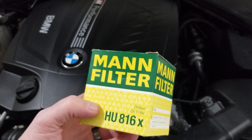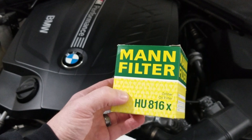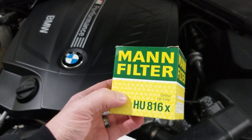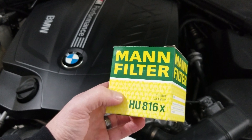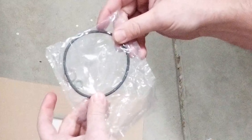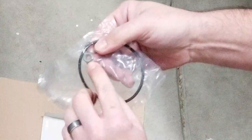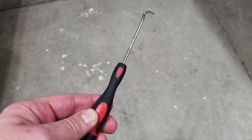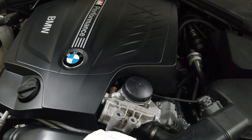Whether you're doing an oil change or not, depending on how long it's been, this is a good opportunity to swap in a new oil filter. In my case I literally changed the oil about 150 miles ago, so I'm not going to replace the filter, but since I'm taking the cap off I am going to change the two rubber gaskets — one on the oil filter housing and one on the end of the birdcage. The ECS Tuning oil filter kit includes the filter, two rubber gaskets, and the crush washer for the drain plug — all for $10. A pick tool comes in handy for getting the gaskets off, and a bag of shop towels always helps.